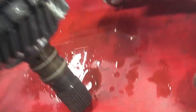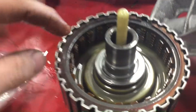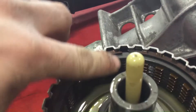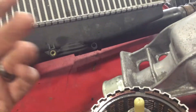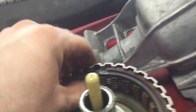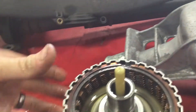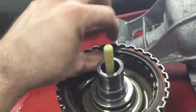These work basically the same as every other hydraulic clutch pack you'd see in any conventional automatic transmission. We have two hydraulic ports down there between the little white plastic rings. As the transmission computer uses the transfer clutch solenoid to apply hydraulic pressure, this inner piston pushes upward and squishes this stack of clutches together. The little brown ones with brown teeth are friction material — like a manual transmission clutch disc or a brake pad — and in between them is a layer of steel. Normally with no pressure, the clutch discs can freely slide past the steel, but when hydraulic pressure squishes them all together, they lock up like a brake pad.